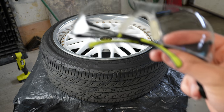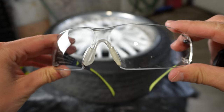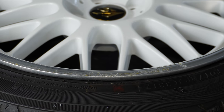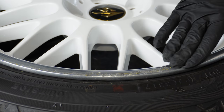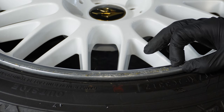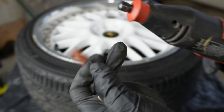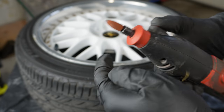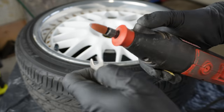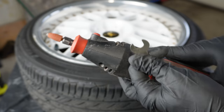So we have our wheels set up and before we get started, let's not forget to have some PPE — personal protective equipment. Put on some safety glasses just so nothing's flying into your eyes, especially when working with metal and little metal shavings. Right here we have a close-up of the area we're going to start working with — it's quite scratched up and quite damaged, and we're going to start off with the file, that's the aluminum oxide bit. Let's get our rotary tool, install the aluminum oxide bit on nice, securely and safely — righty-tighty, lefty-loosey — and we're good to go.